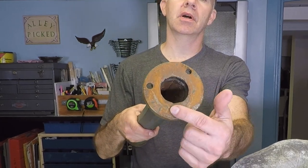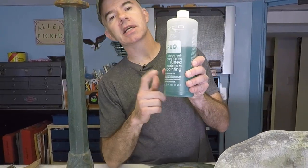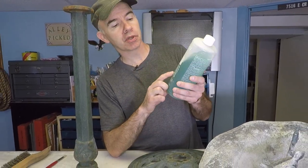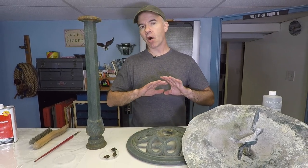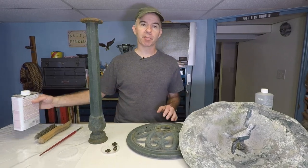There's still quite a bit of surface rust, like in between all these little grooves, and also on the top here. So what I'm going to do to treat that is to use this Osfo. This stuff is great — it stops rust and prepares rusted surfaces for painting. It's amazing stuff. You can get it on Amazon, probably at some auto parts stores as well. Once we have all that treated, we're going to clean it up with some paint thinner and then it'll be ready to prime.